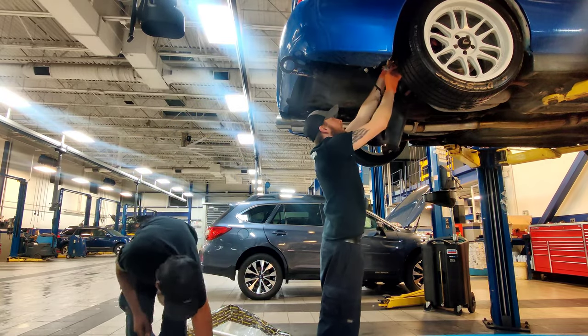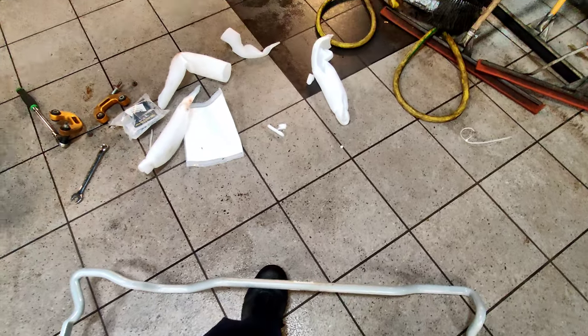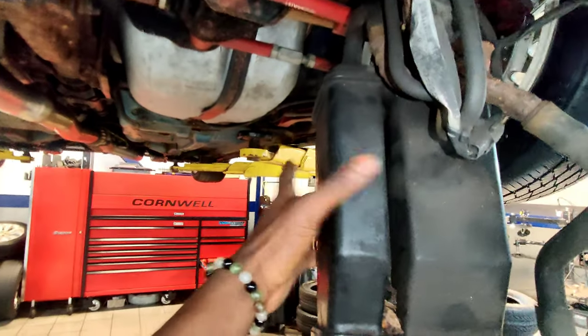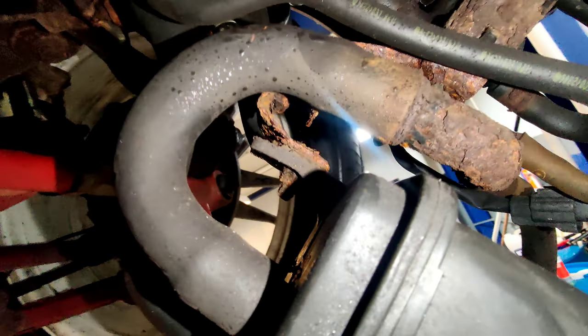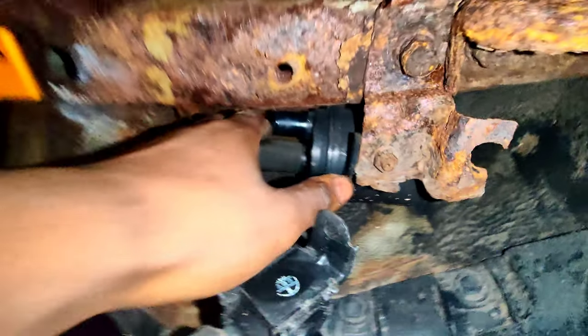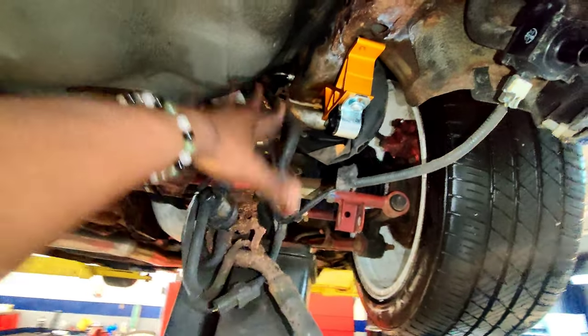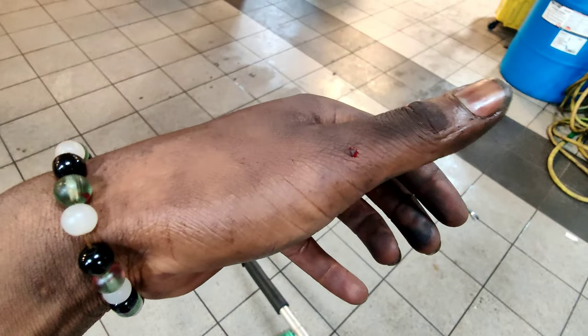Look at that. By the way, the steps to take this off are pretty easy. Two — I want to say 10 or 12mm bolts that are over here, and there's going to be one more in the front. Once you get rid of those, there's going to be a 19mm bolt right here to drop this, and then you just pull that right out. There's a couple hoses and stuff that you want to plug, which I'll get into later because I'm forgetting how to do it. Got the sway bar in, completely in — I got it mounted up and everything.